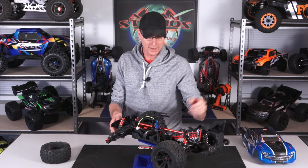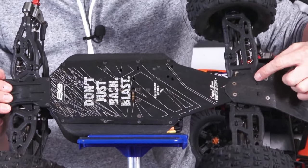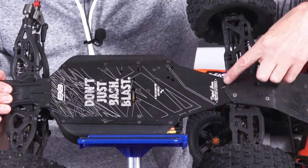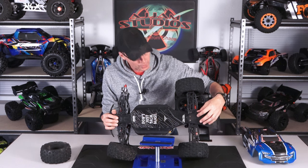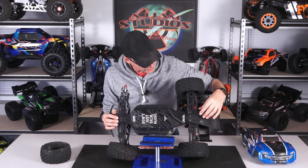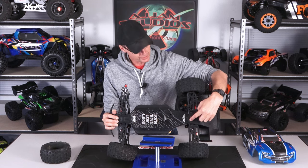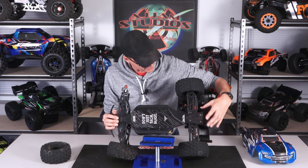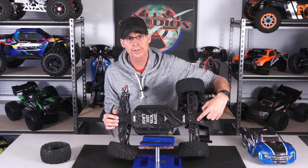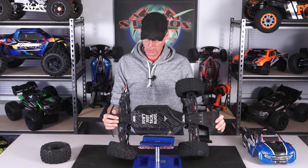But there's a trick to mounting this on the bottom. What I mean by that is if you take a look at this, you'll notice that I don't use these two holes, even though they give them to you, because I've used these before where I just used all four holes, but these are beveled down inside. And so it allows it to move a little bit. And after time, you can egg out those holes and the rear end walks on you. So what I do is I put a spacer in these and I just use fuel tubing, put it on the screws. And when you run it in, it holds center on this. These two mount into the new block that comes with the wheelie bar, and I leave the original screws down in the bottom here to keep that center. And once I started doing that, everything holds up really good.